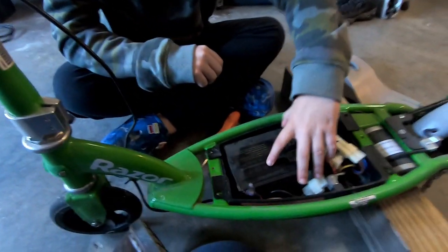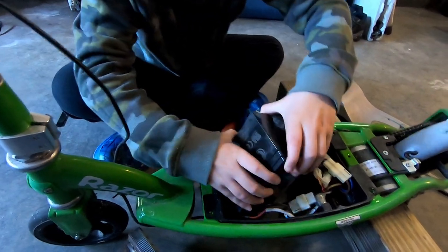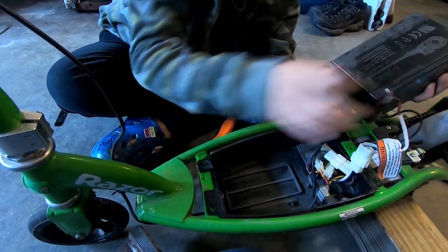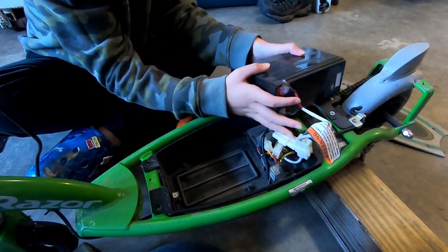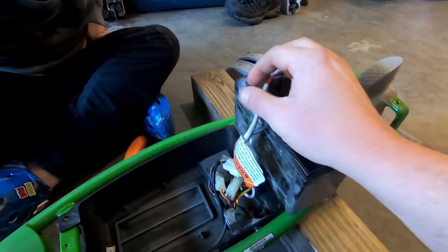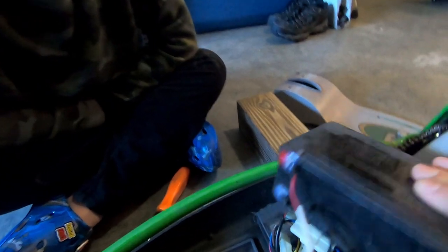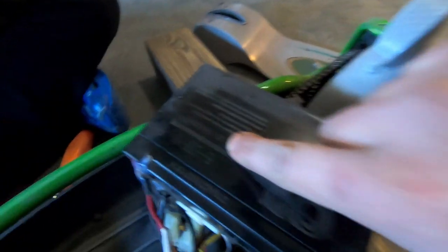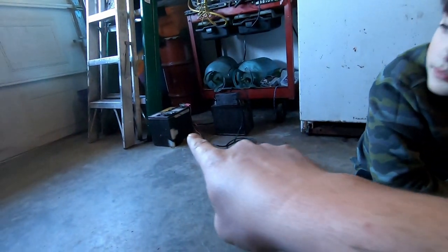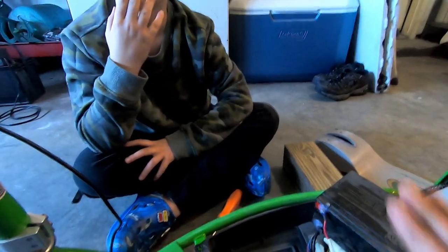Start trying to pull the battery out. Be careful, there's wire stuck to it. It's got a little weight to it, don't it? Just turn it around and set it back right here. Because we're going to have to do something with these terminals down here in the end. Let's test everything else — I'm pretty sure this battery is dead, but we need to test all the electronics. What we're going to do is run some jumper wires from a car battery. It says 12 volts right here, and that big car battery over there is also 12 volts.